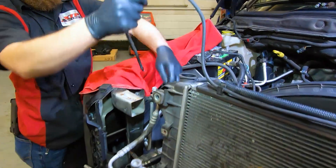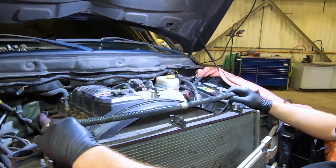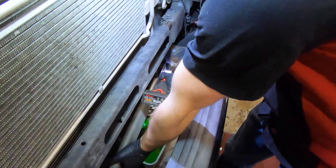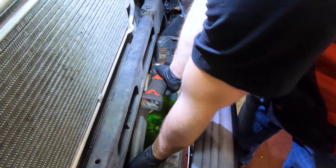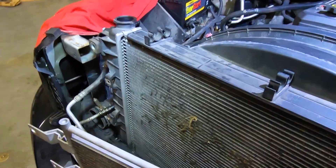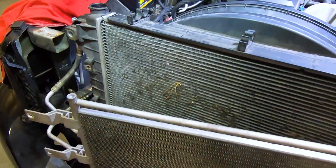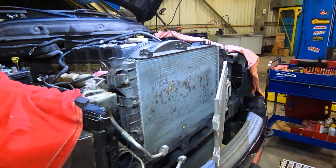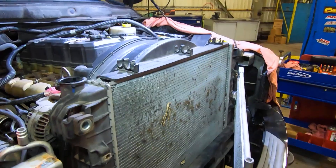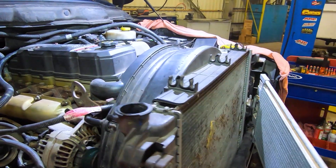You'll need to disconnect and remove the windshield washer fluid hose. You're going to remove the wiring harness and move that to the other side of the fan shroud. Next you'll need to unbolt the power steering cooler from the bottom of the radiator — this is held in place with two 13 millimeter bolts. You'll remove the upper and lower radiator hose from the radiator and then you'll be able to lift the radiator out. Whether you're installing just the radiator or the radiator and electric fan system together, you can remove the factory radiator without disconnecting the factory belt-driven fan shroud and clutch fan at this point.